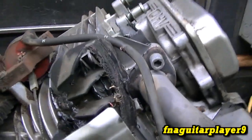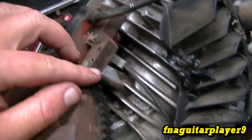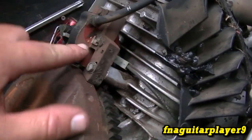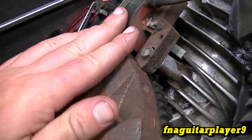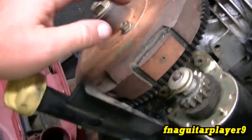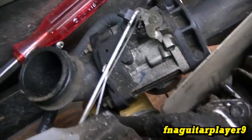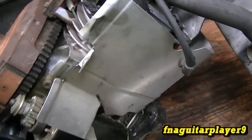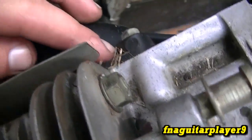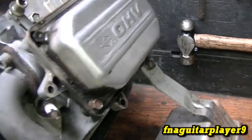I'm hoping that's all that's wrong with it besides possibly a warped head, which I can surface. I also ordered a new coil — I don't know if this one's good, but if the block got that hot enough to melt plastic, this coil is probably weakened, so I went ahead and ordered another one. I already have plastic fins off an older engine that should bolt right on. The carburetor probably needs cleaning since it's been sitting a while. Surprisingly, the plastic intake manifold didn't melt to the block. I'm going to pull the valve cover off before we start tearing it apart.